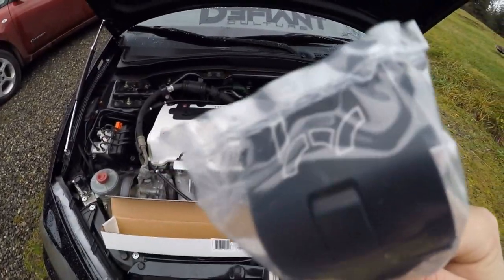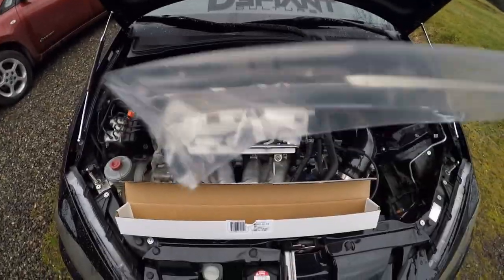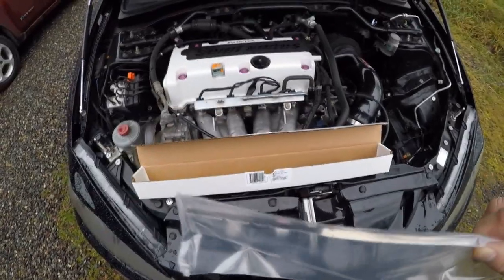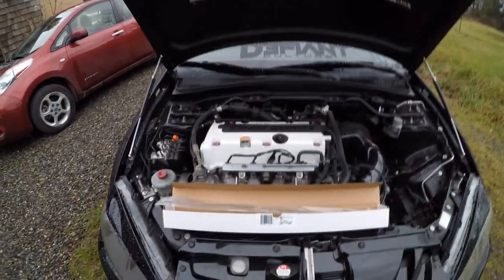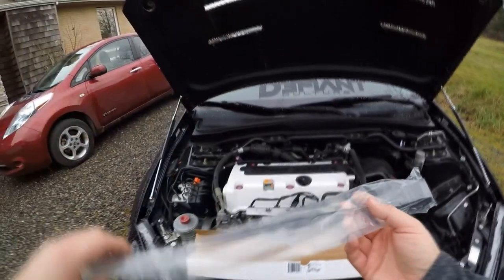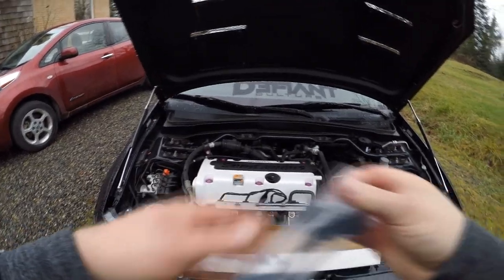It's a super slim design on the front, even got the logo right there, and it's got a couple different notches depending on what K-series motor you have. This RSX is the K20Z1 motor, '05 or '06 Type S — so the first two notches are low and high for oil level. It's a pretty universal dipstick for K-series motors, not just meant for the RSX; you can use it for pretty much any K-series.